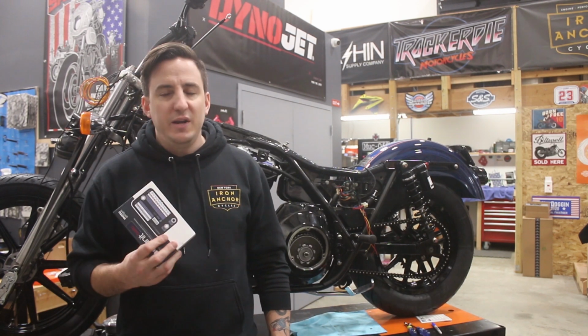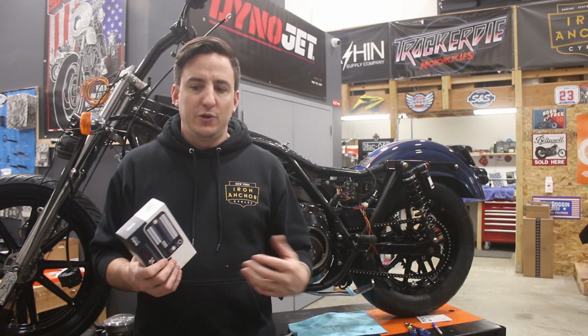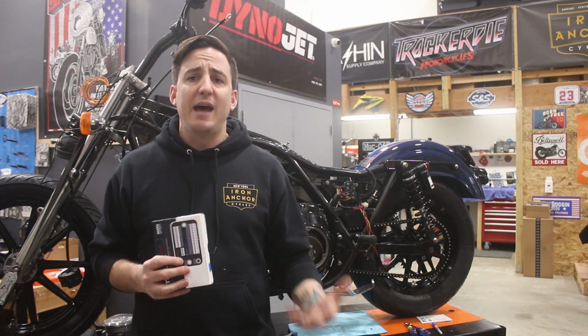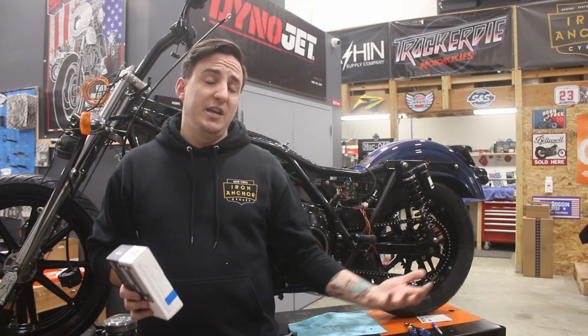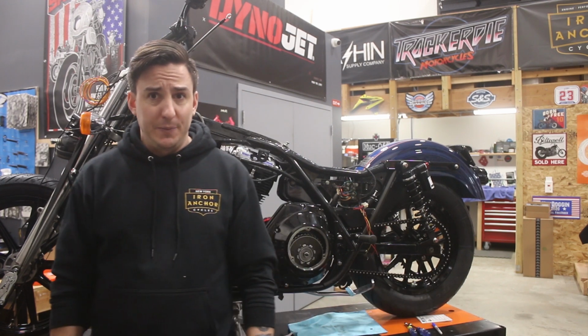So those little things are not necessarily a good enough reason to do this. Really, the beauty of this is that the electronics are going to be 100% functional with new wire. Everything is going to work right. And these are also really easy to diagnose electrical problems with. So basically what we're doing here is getting out in front of any issues that may occur by starting from scratch and running all new wiring.